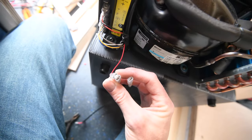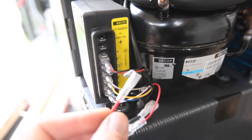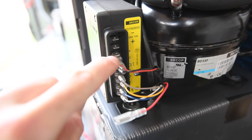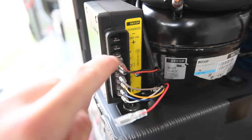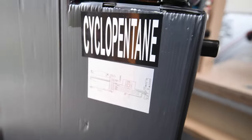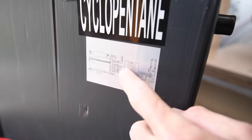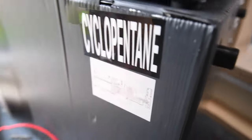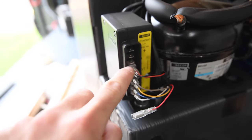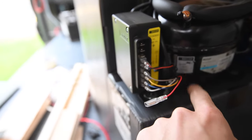The factory connectors don't want to come out easily. I'm trying to figure out where the piggyback connector went. Looking at the wiring diagram on the side of the fridge, it doesn't show the main positive piggybacking — it shows the next one down piggybacking. I'm going to presume there's no difference piggybacking off the main positive, since this is also going to be the positive going to either the fan or the compressor itself.